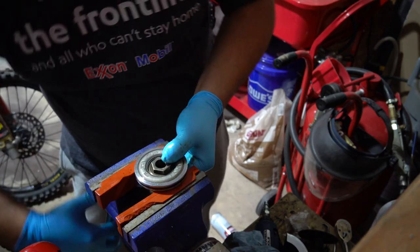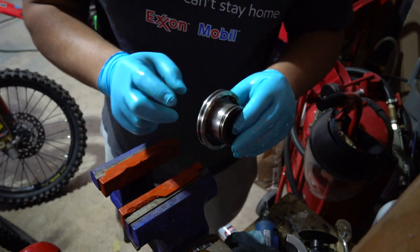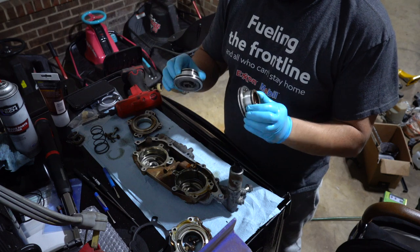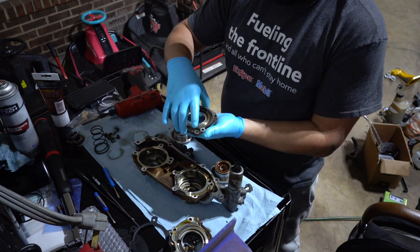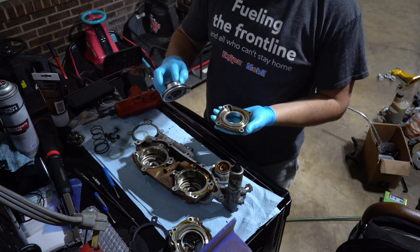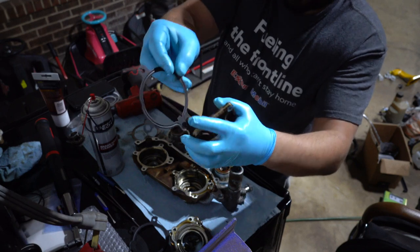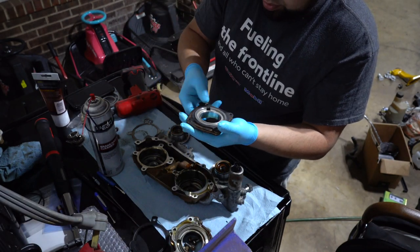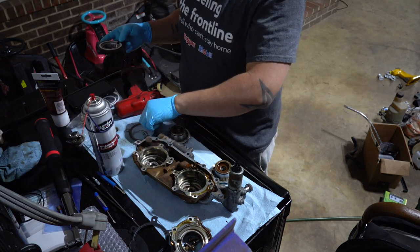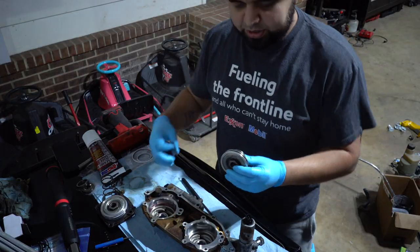That's how you do the rattle kit. We're going to go ahead and do the rattle kit on the other piston as well. Now that both rattle kits are done, we're going to clean the caps off with some brake cleaner, wipe them down, and put the new gaskets in. Then all we have to do is the ring seal kit and we're good to go. The gaskets have a little tab right here so you don't put it on the wrong way — there's only one way it can go. Now that we have our new gasket on, we can set this to the side. All we have to do now is the ring seal, so we're going to want to cut the O-rings kind of in a diagonal form.